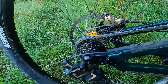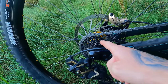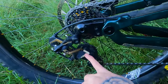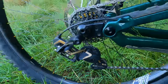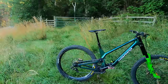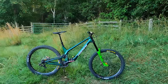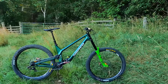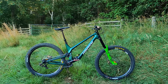On the topic of not running 12-speed, we have a 7-speed here - the 7-speed SRAM cassette. We have an 11-speed chain, which actually works with 7-speed, which I didn't know. Then we have the TRP DH-7, which is a super short cage mech, and this setup works perfectly. My main thinking behind this was short cage mech for more clearance and better range of gears so I wasn't spinning out on the high-speed track. Really clean setup - thanks to TRP for that.